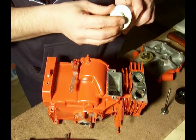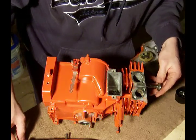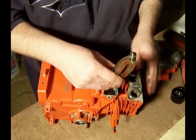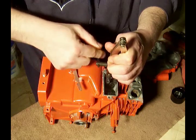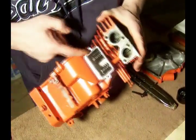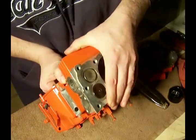Once again, we take a little bit of grease and grease up the valve. Slide it into the hole, and then before it comes all the way through, put the spring in place. Once we know it's in position, we release the spring. And we see that the spring is now in place. What's going to happen is the tappet is going to be in the hole and it's going to open and close the exhaust valve.